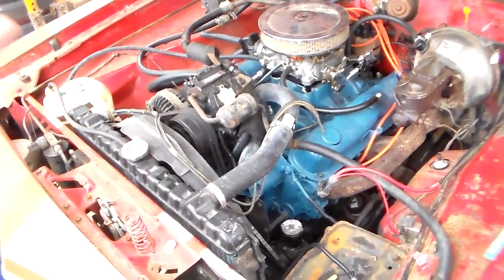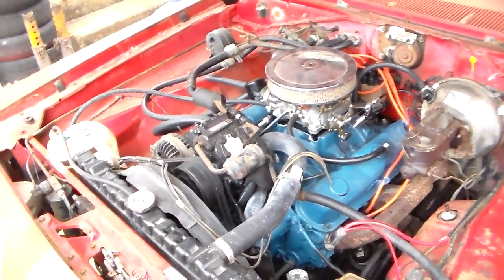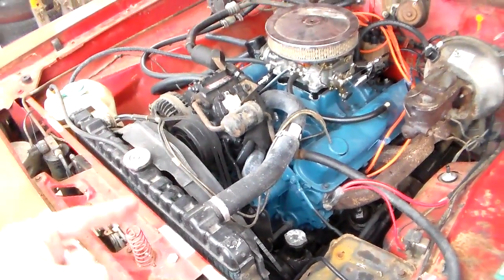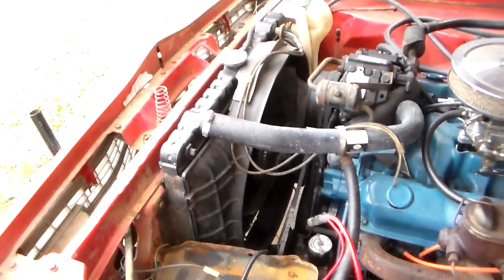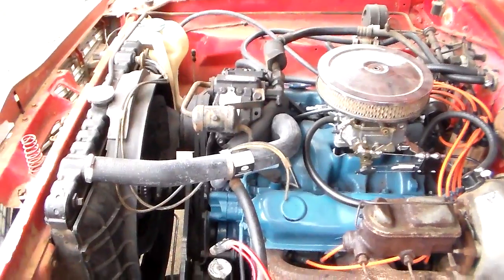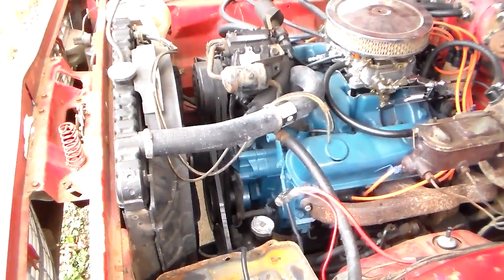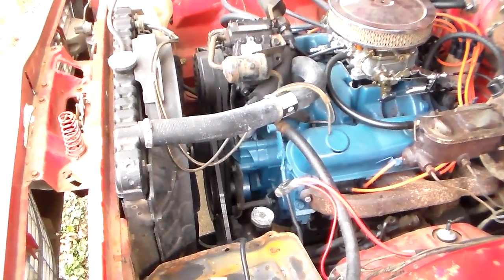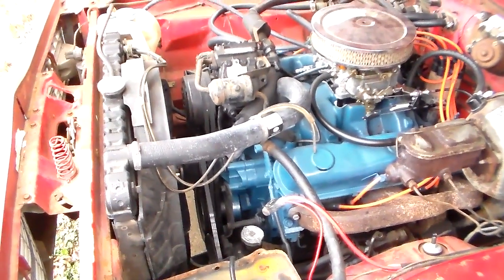What's going on if you have the opposite condition? If you have an engine that, as long as you're out on the highway moving it stays cool, it stays pretty cool climbing a hill, but you get in the city and slow down and idle — up goes the temperature — well, usually that's because of an airflow problem. Something's going on that you're not moving enough air. This car has a thermostatic cooling fan that reads the temperature of the air coming through the radiator, and when it gets hot enough it kicks in and cools the engine down. That's the formula for figuring out where your cooling problem is. Don't go throwing a water pump on unless you have a legitimate need — it's leaking, it's making noise, it's rattling, or you've established beyond a shadow of a doubt that it's not moving coolant. Then replace it. Otherwise, don't.